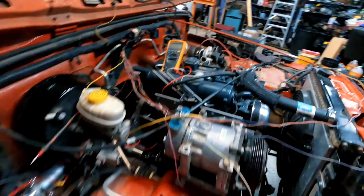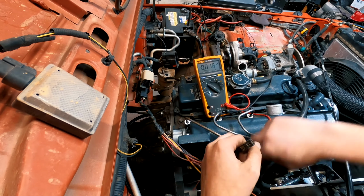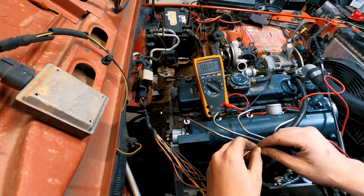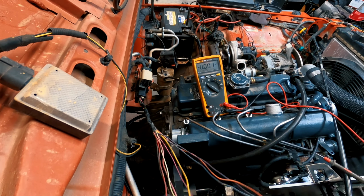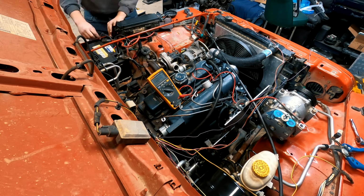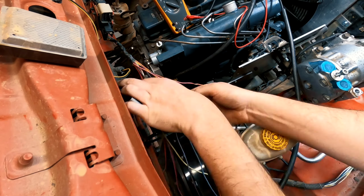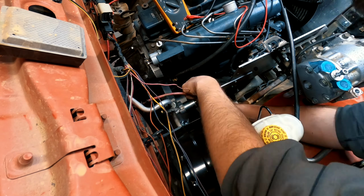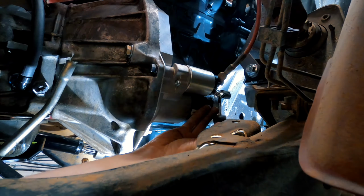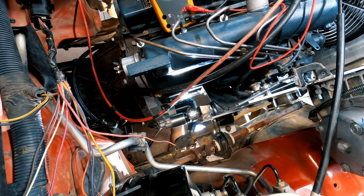With the wiring harness that I had cut out of the original engine bay wiring harness plugged back into the Wrangler, I then used my multimeter to locate the starter solenoid wire. With the correct wire located, I can now wire up the wiring harness to the starter motor solenoid. It was here that I realized I wasn't able to remove the Phillips head screw on the starter solenoid, so I was going to have to remove the starter from the AW4 automatic transmission.